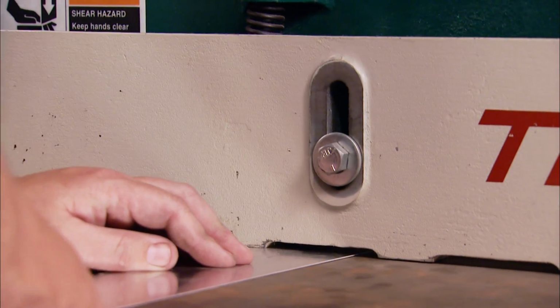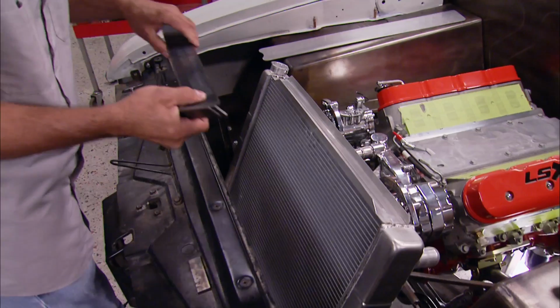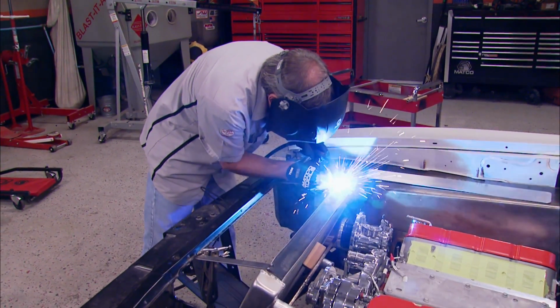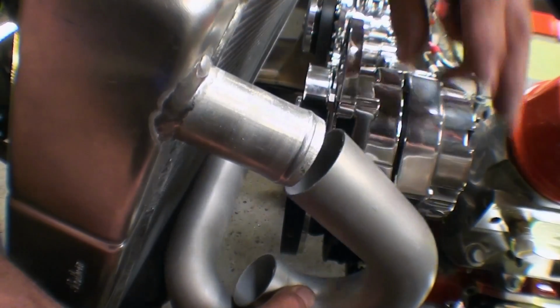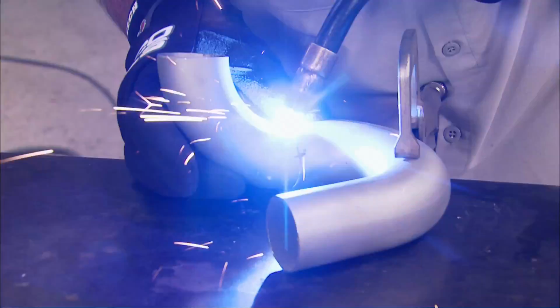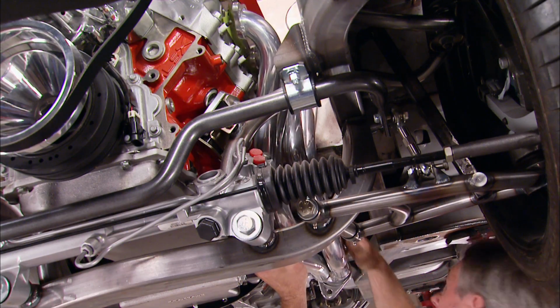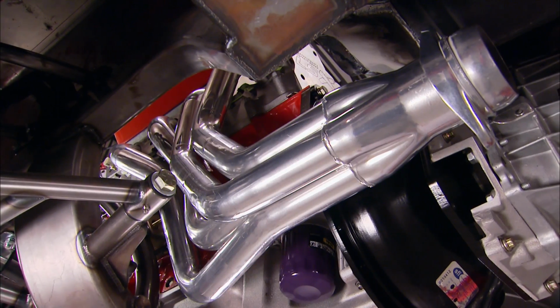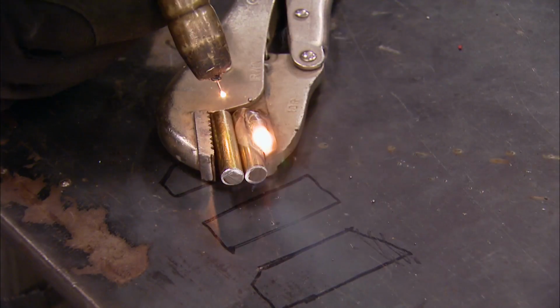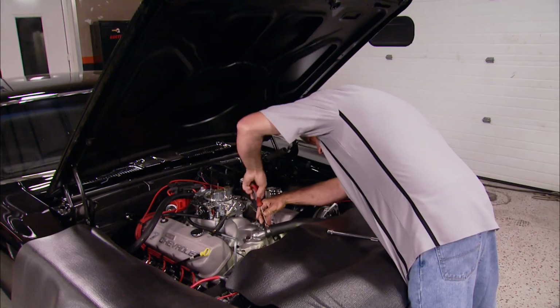Today on Muscle Car, we put the rad in radiator as the '69 Olds Cutlass Restomod gets a Corvette-style cooling core, but that requires even more mods on this customed-out car. Some one-off coolant tubes built from scratch round off that stuff, but we'll also show you how the right headers can be a snap to install, custom fab some stainless exhaust, and make a purpose-built tool along with modding a thermostat for efficiency.